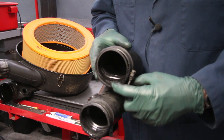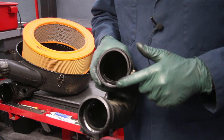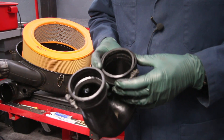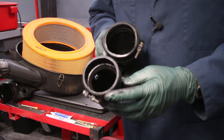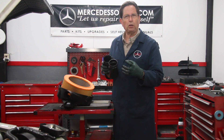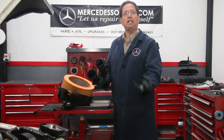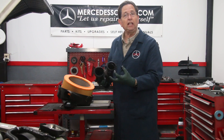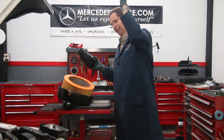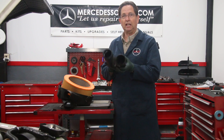This happens because of the design of the seal itself — it's very hard to put the seal on and push it on without the seal getting pushed back. I just removed this from Casper and look at how the seal on the bottom has been pushed back. In more than 70% of the elbows I pull off these engines this top seal has been pushed back, and the bottom seal, because of the heat from the turbo, gets really hard and won't seal either. Because of the turbocharger compressor sucking a lot of air, with the restriction of the air filter, any leaks in and around this elbow mean unfiltered air is getting sucked right into the turbocharger and into the intake manifold and combustion chambers.